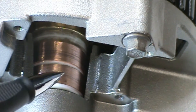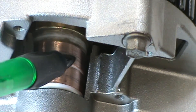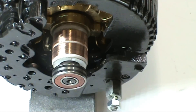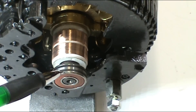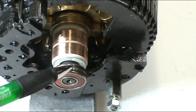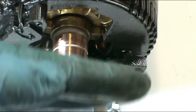Those two brushes ride on two copper rings down inside the alternator. This is called a slip ring — it's made out of copper and it's soldered to the windings in the rotor. The slip ring, which is these two copper rings, is actually part of the rotor itself. With the rear plate removed, the slip ring becomes better exposed and you can also see the rear bearing. This rear bearing is a floating roller bearing, with two Teflon rings inserted into the outer race of the bearing itself, which helps the bearing to float laterally.